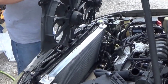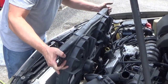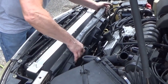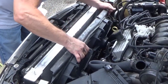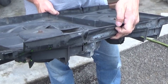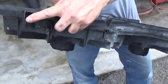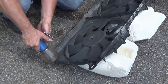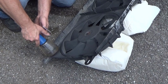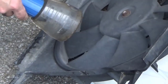The next step is to put the electric fan shroud back in. It turns out the only complication is that the factory fan shroud will have to be modified to fit this larger size radiator. The bottom lip sticks out a little bit too far and has to be cut off — probably about a quarter of an inch — for the pieces to slide into the little hooks on the radiator. I'm using a pneumatic cutoff wheel here but you can use an electric one or different types of saws — it's plastic and pretty easy to cut.